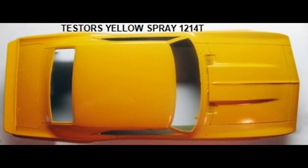Paint on a vehicle this size is pretty important. And how I approach it is to usually start with the underside, the wheel wells, etc., and then around the outside perimeter, and then over the trunk and hood and the roof. Now, it helps if you put a couple of light tack coats on there first, just to get the paint to start adhering. Wait about 10 minutes and then start some medium coats. You're going to want to put at least one or two medium coats, and then about 30 minutes later add your nice full wet coat for a good shiny smooth finish.